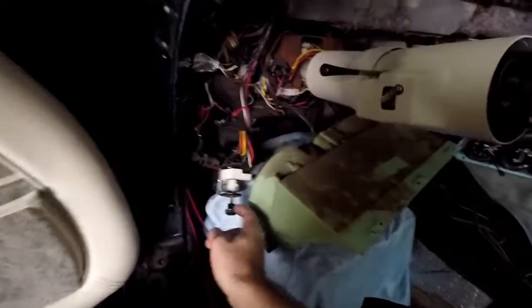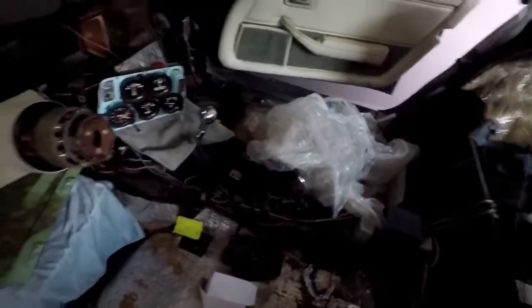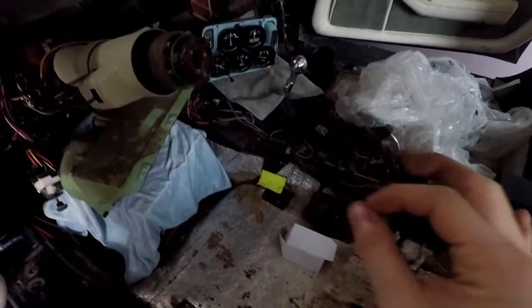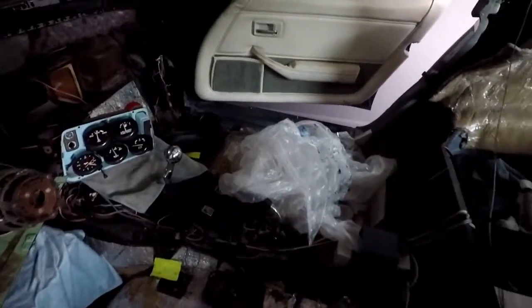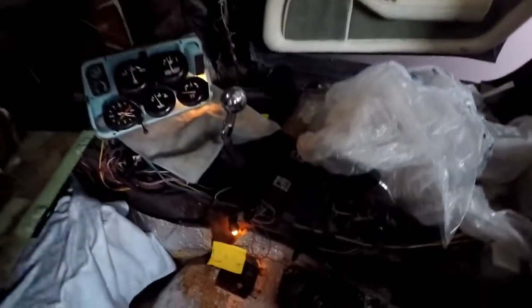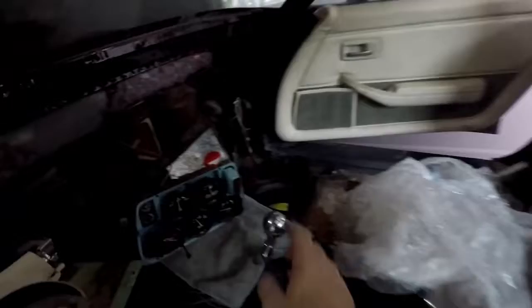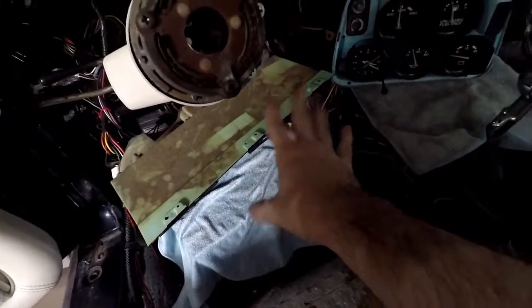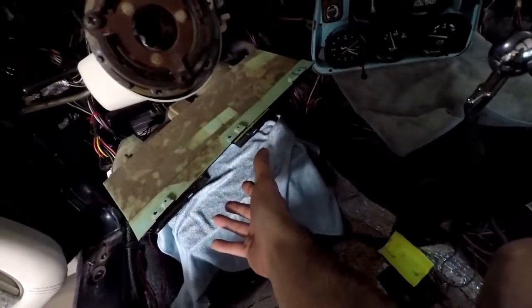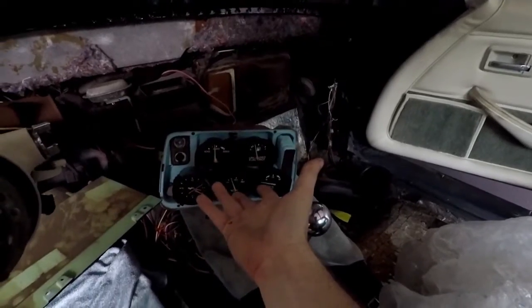I got the lights to the on position. Turn the brightness up a little bit. When I switch this to on, you're going to hear a buzzing noise — I think that's the seatbelt alarm, kind of annoying, so I'm just going to be real quick with it. Turn it on — we have light. We have one light. No light there. So in the instrument cluster we have one light bulb down here, which means the other ones aren't working. We have no lights here, which is kind of concerning. Either they're all burnt out or we have something else going on.